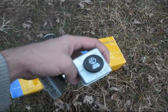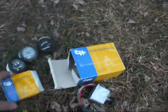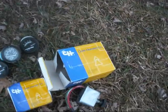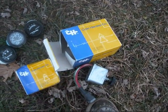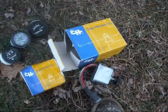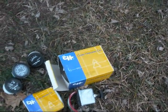Let's move on to some more updates — some other parts that I got online. Got a new wiper switch; this is an intermittent wiper switch. I actually got three of them here. Got that one for $39, and these are both $40 a piece plus shipping. The All-American has intermittent wiper switches but it has two separate ones, so they said this switch should just plug right in and replace those two. The other ones will have to hardwire in somehow.